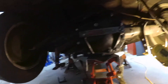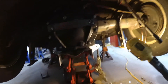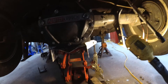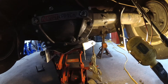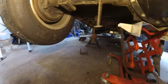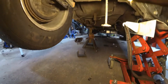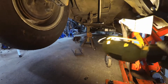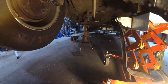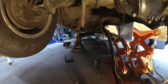If you look around this car, it's very simple. It has an 8.5-inch rear end with S10-length axles, so anything I need for this vehicle is readily available. If you look down the car, you can see it's all still the factory floor pan all the way through. The only part that's been replaced is up front at the driver and passenger side — replaced with flat sheet metal, because these cars weren't known to stay solid for long; they start to rot out.